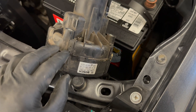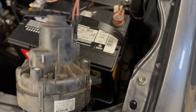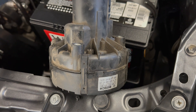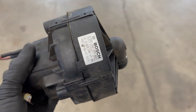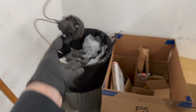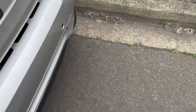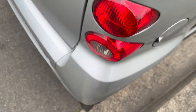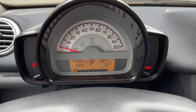Here I've got the old one — you can see the part number — I welded some wire to it to bench test it. This is the same one I just pulled out of my car. Ready? Hear that? That's how you know the bearings are bad inside these. This belongs in the trash. Here's what it should sound like with a cold start — that's exactly what it should sound like. You shouldn't really be hearing anything. Everything's fixed — hope this helped, have a nice day.